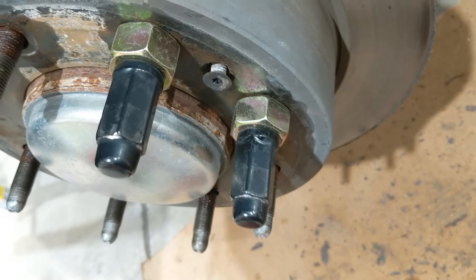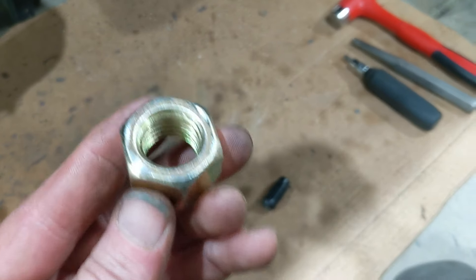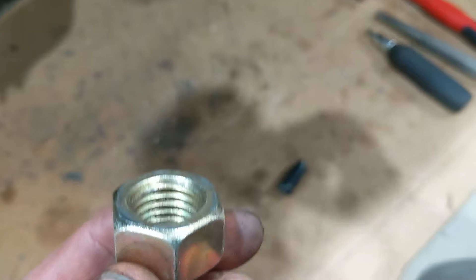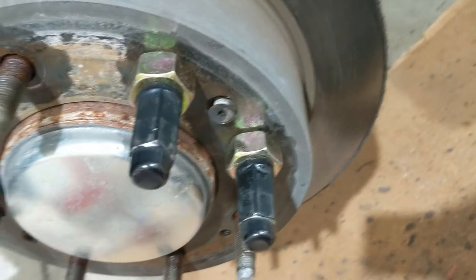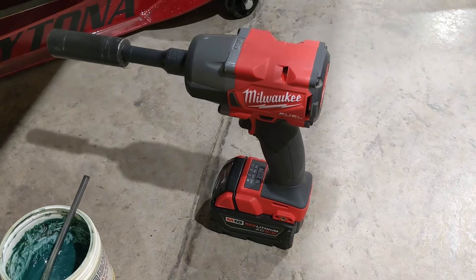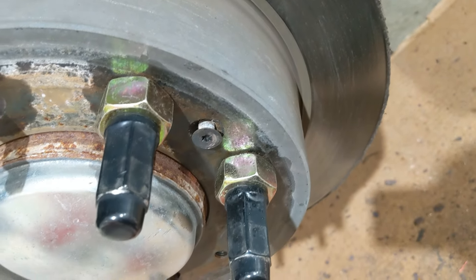Since this isn't my truck, I wanted to protect those lug nuts. I used a three-quarter inch grade 8 nut, and you can see it has a nice chamfer to accept the fancy lug nuts — that worked well. I ran these down pretty tight using my Milwaukee compact half-inch impact on setting two, which is probably around 150 to 200 foot-pounds. That really pushes the rotor hard up against the hub.